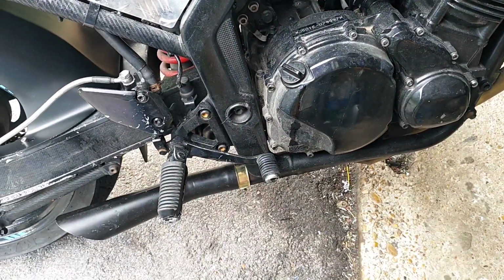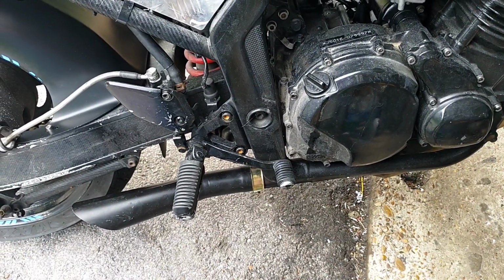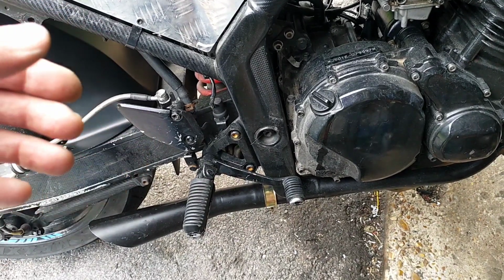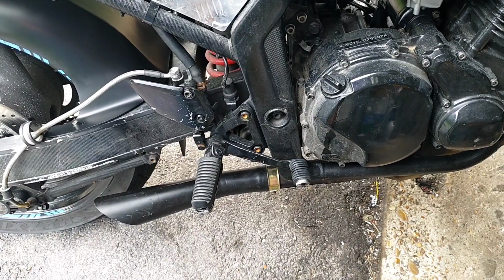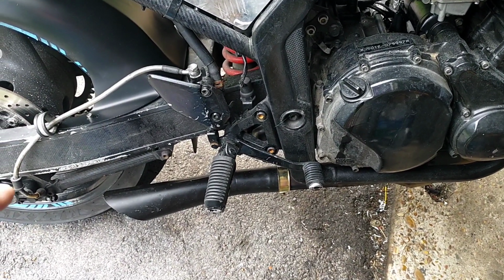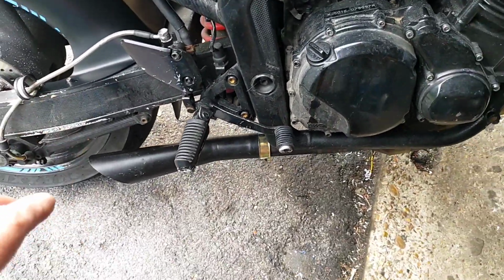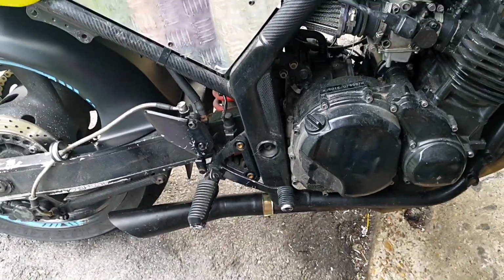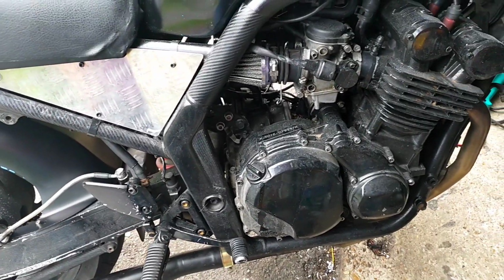I've never blown an exhaust off before. My fault, I'd over restricted it, trying to keep the noise down, and I'd closed the baffle on the inside just too much, so that's why it was struggling. It just didn't have airflow. So yeah, lesson learnt, don't over restrict. I was kind of lucky I didn't damage my car or something else with that, I suppose, with the exhaust flying off. But hey, that's the first time for everything, hopefully a last time.